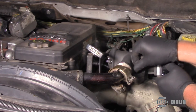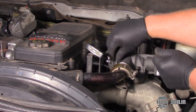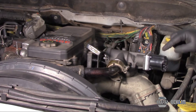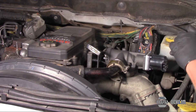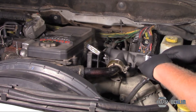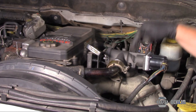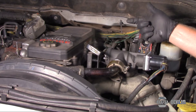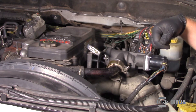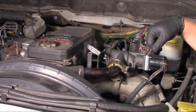The gaskets — I'm going to have my clamp slid into place and make sure everything is all set before I start locking stuff down. You'll also notice that this new valve has the correct clocking of the solenoid. Now I can take my electrical connector and pop that in place. Once I get all these bolts tightened down and locked down, I'm going to go in, clear any trouble codes that were set, verify that the circuit codes did not return, and we're ready to go. Hopefully now you have a better understanding of what it takes to replace the EGR valve on our early 6.7 Cummins engine.